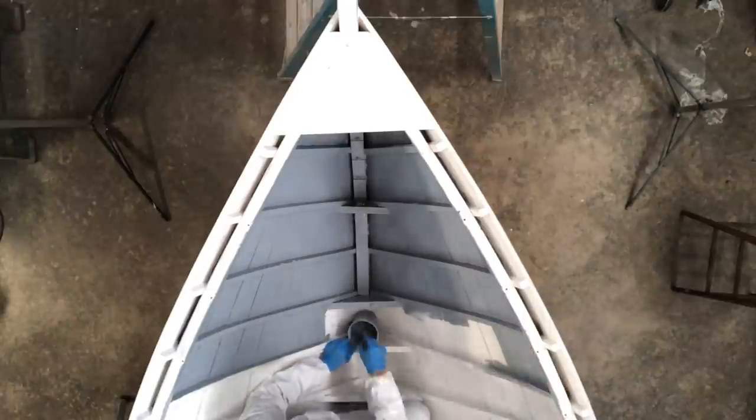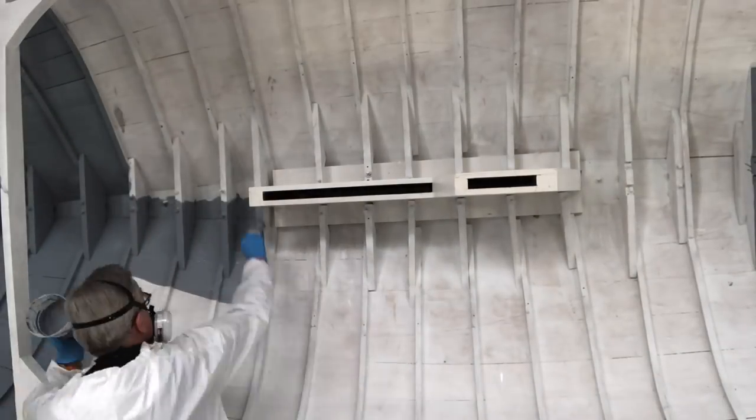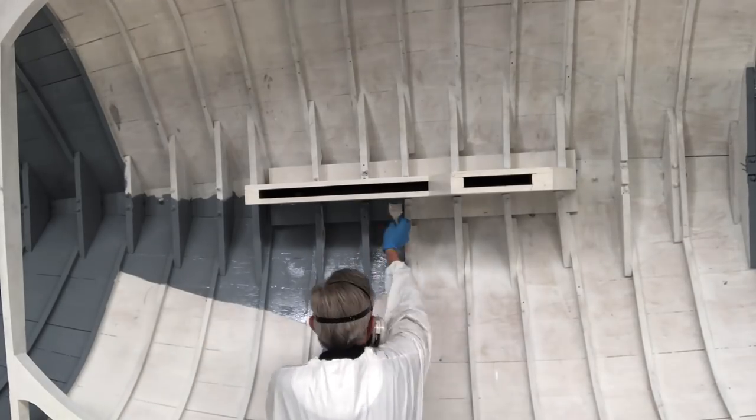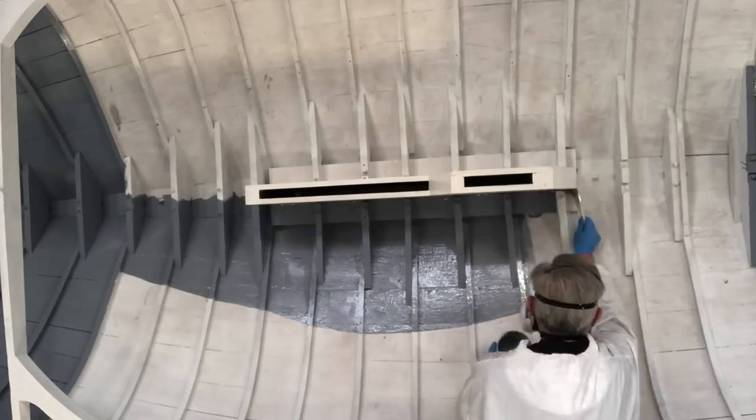Epoxy paint is quite different than epoxy resin. Epoxy cures while paint dries as the solvents evaporate. Total Boat is epoxy paint, not epoxy resin. I divided the painting into sections, painting the aft first, then the fore section, and finishing with the midship. I ultimately put two coats of paint in the bilge.